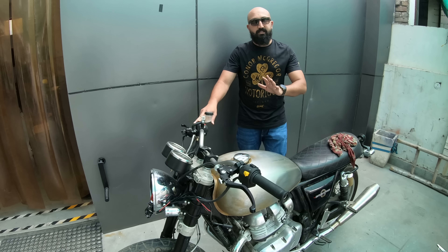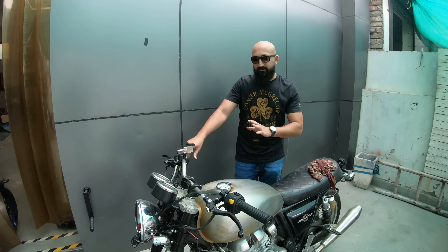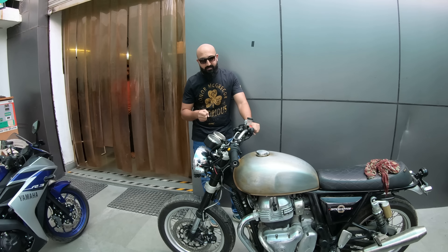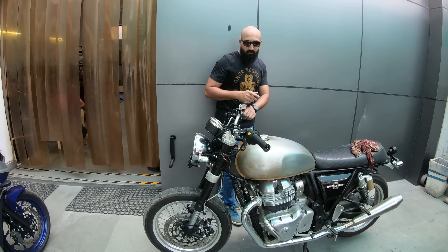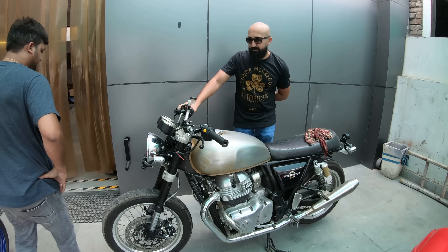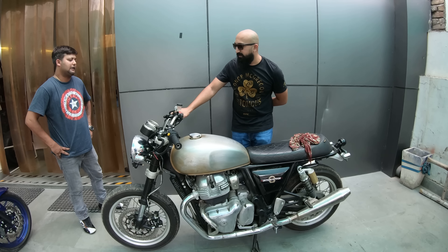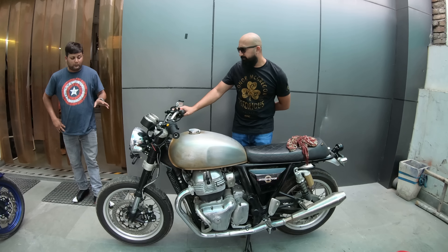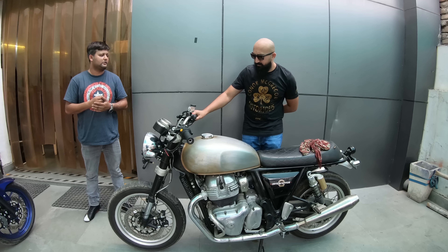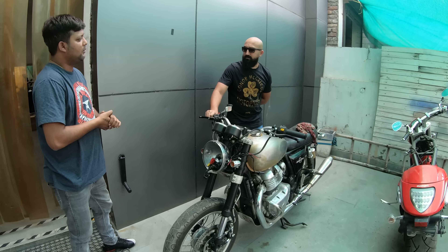This is the major work going in on the motorcycle right now — this is just a teaser. The bike is not ready yet and final testing remains. Right now the problem we are facing in the build is the front suspension. Even with heavier fork oil added, the front suspension is still not taking the weight of the motorcycle very well — we'll have to look for progressive springs. When we brake, the motorcycle pulls to the right. It could be because it's an older suspension that might have gone down, so to hold that back we need a heavier spring.